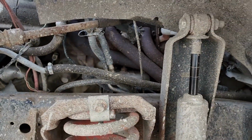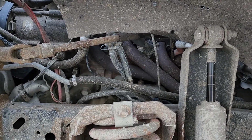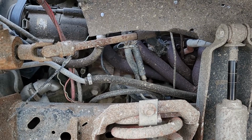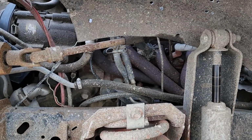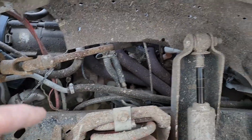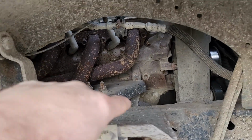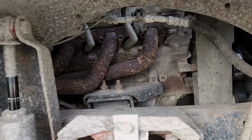And those of you that know, these 5-liter V8 Explorer engines have some of the most convoluted, nasty exhaust manifolds. These are Hedman shorty headers for, I don't know the part number, a really early Falcon or Mustang V8. These are a really popular header to use for V8 swaps in older Rangers that have the twin I-beam suspensions. I'm pretty sure these would not work here, not so much on this side, but on the passenger side, all the brackets for the independent front suspension would have gotten into that header, if I remember right. But they work pretty good in this for doing the solid axle swap.